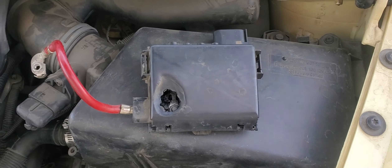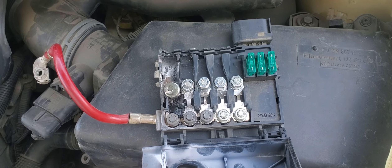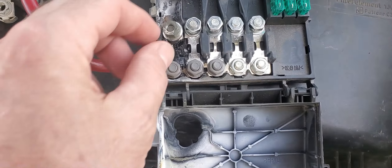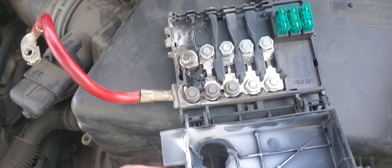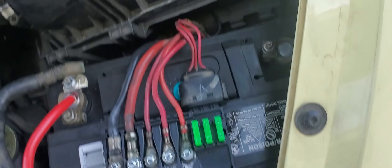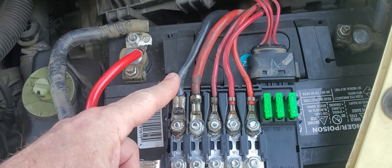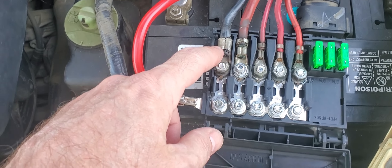Back at the beetle today. As you can see, had a little meltdown in the fuse box. It's a pretty common problem — seen a lot of videos and information on it. Basically it's just the wire coming from the alternator that hooks in here and it just melted a hole right through the box. So I got a new fuse box, hooked it up, and this wire is still getting blazing hot coming off the alternator. It's pretty much a resistance problem I'm thinking.